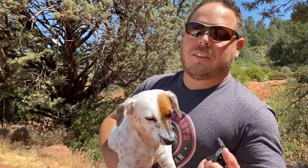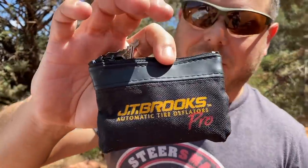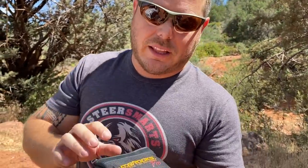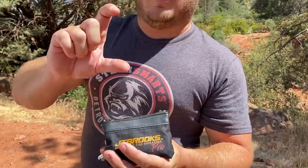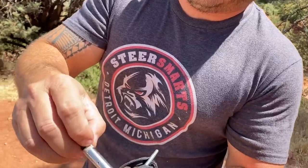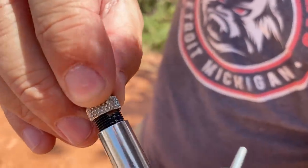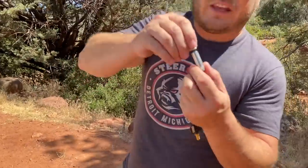I wanted to take a moment to answer a couple questions that we get all the time on the channel. First off, airing down. Airing down could be done a ton of ways. The way we do it is with JT Brooks Pros. No, they're not a sponsor. This is just something that we bought that we really like. The Pro actually has numbers on the device so you know exactly where you're gonna be airing down to. You unscrew this guy here. See those numbers right there? That's your PSI. The only thing to keep in mind is that when you set your PSI depends on your elevation. Depending on your elevation will depend on what the actual final pressure is.